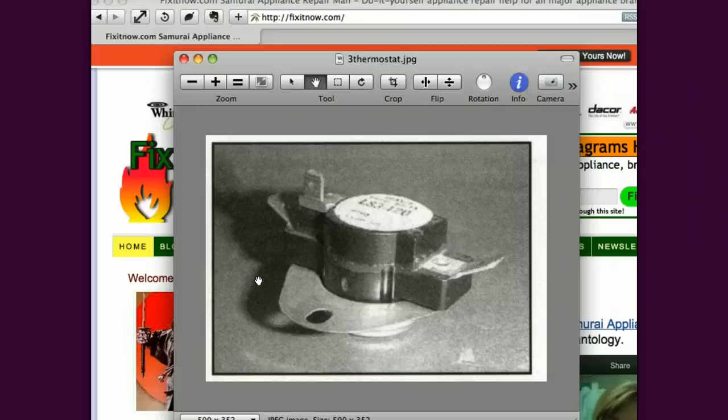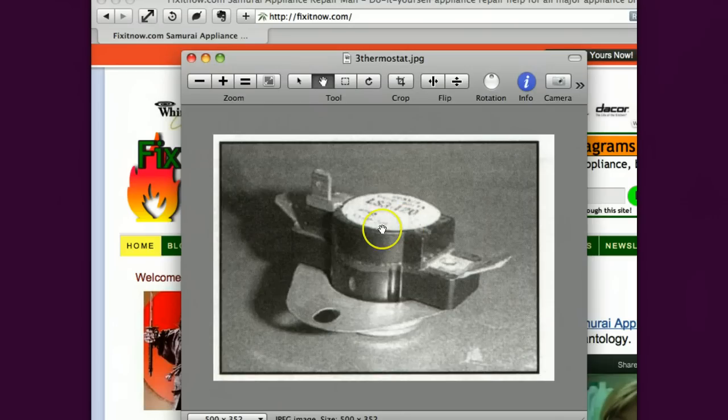So that would be your thermostat that's bad. Really the only way to check that is by putting it on an electric skillet where you can set the temperature, and at a known point that it should open — which is written on the top of the thermostat — it should open accordingly, and you can use your ohmmeter to see when that continuity opens and goes to overload. Other than that, the other way to do it is simply by elimination. You look at the element, you see it's good, it's not bridged, you don't have any kind of electrical path from the element itself to the ground point on the dryer — then the problem has to be the thermostat.